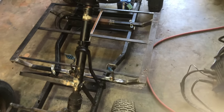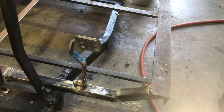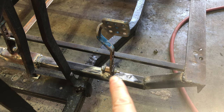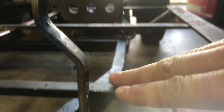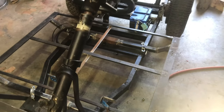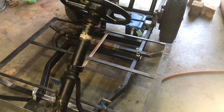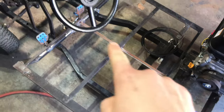That's a couple days later and I have just slowly been kind of working on this little cart. I've built the little pedal latches, the little hookups for the pedal, and I've made them where I can adjust it just a little bit if I need to. I really would like to put them on the floor — the floor is actually going to sit up here. That worked as a really good stop when the pedal pulls back. I had him sit in it yesterday and it seemed to be about the right height for him based on the seat I'm planning to put in there. I added a brace support to the middle of the floor right here.